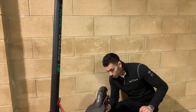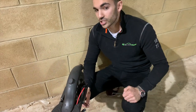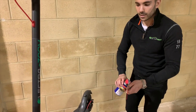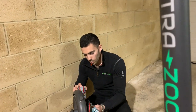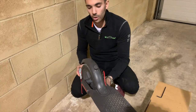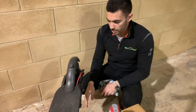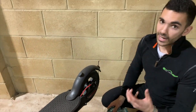While you're here, have a good look at the rear disc — make sure it's not bent, nice and straight. If you're getting a slight grinding noise or it's catching in certain places, the disc might be bent. You also want to make sure the rear wheel is nicely lubricated with a little bit of WD-40 — just a slight spray just inside where the wheel's mounted on either side. Avoid getting any on the disc or pads, and wipe it off before riding. Give the wheel a good spin; this one spins really easily and freely, which means you go quicker and get better range.